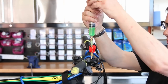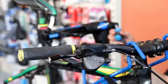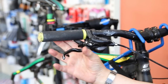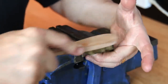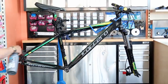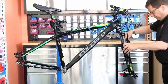We're putting fresh fluid into the front brake, cleaning everything with brake cleaner afterwards, burping a few bubbles out of the lever, then tightening everything up. You can see what a solid brake we've got now — safe and sound. With the pads we clean them up with a brass bristle brush and skim them on our belt sander, which takes a lot of the debris out. The brakes are bled, pads sorted, and everything's ready to go back on the bike.